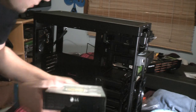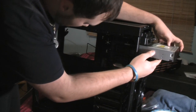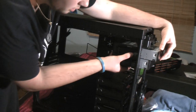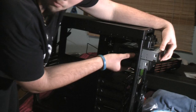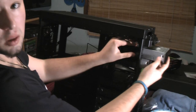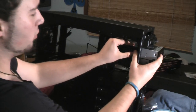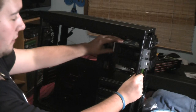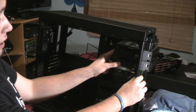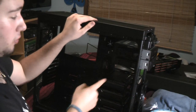You've got your optical drive and the bay — you literally just line it up to go straight in the front. As it's going in you'll see things start to move, and when it starts to get a bit forceful you grab this little movable tab here, push it in, and gently push it back in again. At the forceful point push it in and use a bit more force. If it goes too far back, just push it forward and it will click into place so you can't push it out or back in any further. To take it out, simply push that tab and pull.